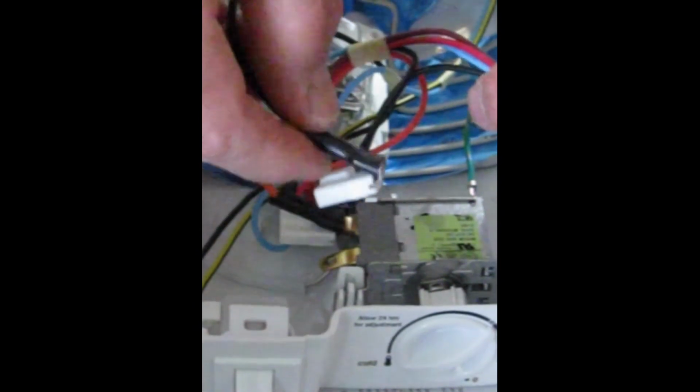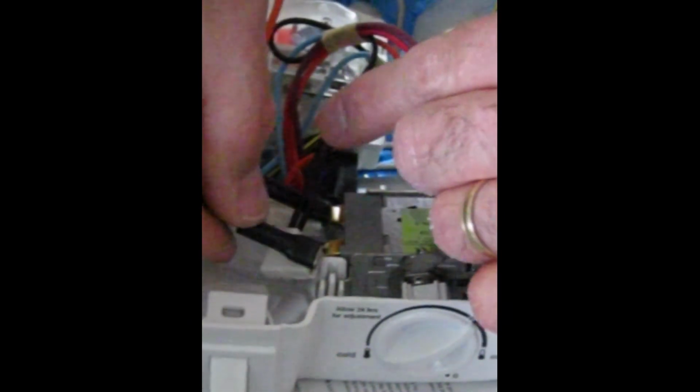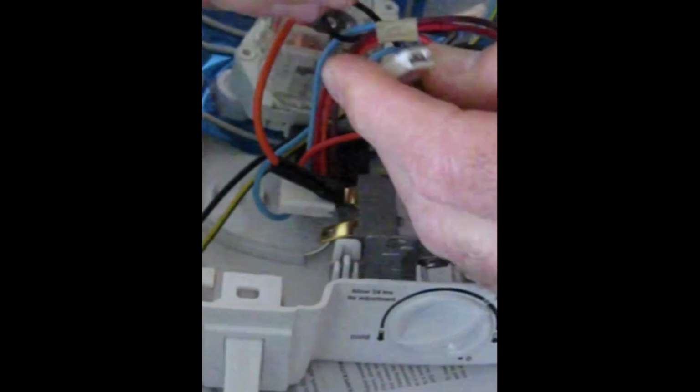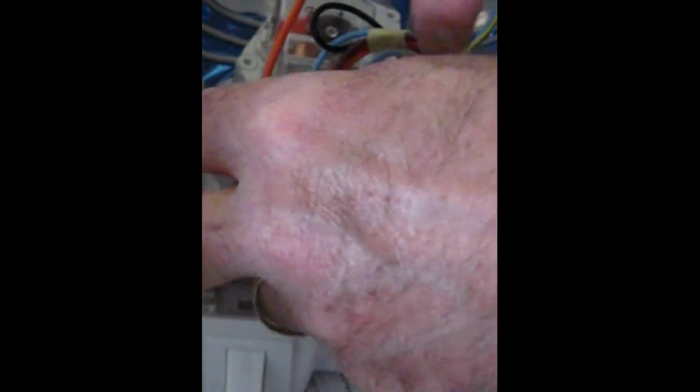And now we're going to plug this one in. I think we're going to do this a different way. So I think what we will do is move this under this orange wire, and we may have an easier time attaching it afterwards. So here's the tab of the black heater wire, and it's going into the black connector for the cold control. Now we've got that.